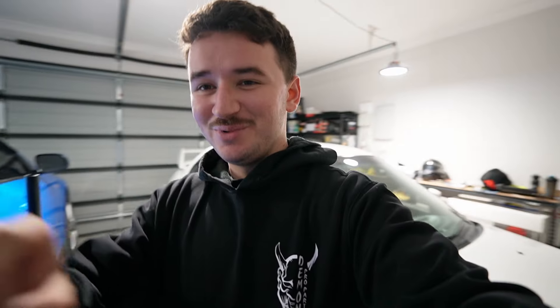We're back in the garage - it's been two days. I took the tail shaft down to GJ in Dandenong and they got the whole thing reconditioned. It's a bit more expensive than I thought, but they did a brilliant job - the thing is all nice and powder coated black. The two CVs ended up getting replaced, as well as the center bearing, all new boots, and a new rubber guibo. The guys assured me this one should last up to about 350 kilowatts depending on how we drive it. They turned it around in like half a day, so stoked about that. I'm going to put it back in the ute and take it out for a drive.